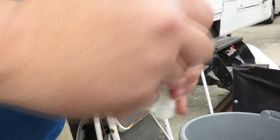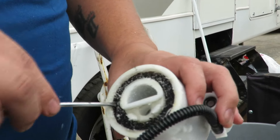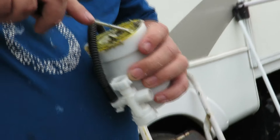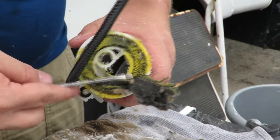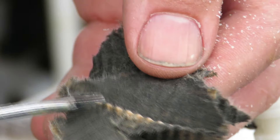When a fuel filter is new, it's a tan, off-white color — and that's ours. The yellow is the sock; the gas in there took the paint off of it. See that tan color still left on the edge? That's the color it was when new. The light tan pieces show you how it looked when it was new — big difference compared to how dark and black ours was on the inside walls.